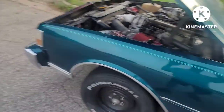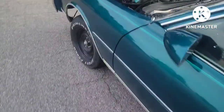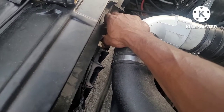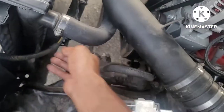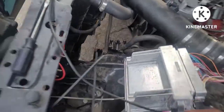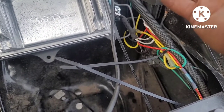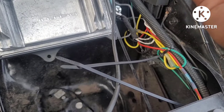I put external relays outside of the relays that were already on here, because that's just for how they wired the fans up to come off that plug. Like I said, I still put two other external relays on it to give it the full 12 volts, so both fans will have full 12 volts and operate at maximum speed.